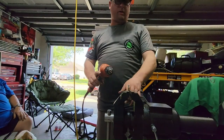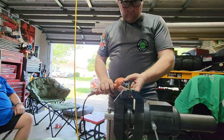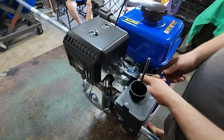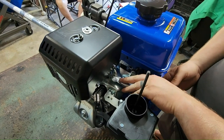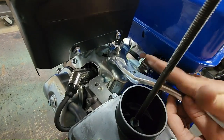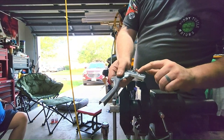This is our throttle cable — it's got two small-diameter holes for the cable. I'm going to be drilling it out with a 5/64-inch drill bit — that's the size of my cable; yours may vary. I'm going to take the throttle control arm off so we can drill a hole in it to run our throttle cable through. When you're doing this, you have the spring set up right here — be careful not to bend your springs. There's another spring in the other end down here.